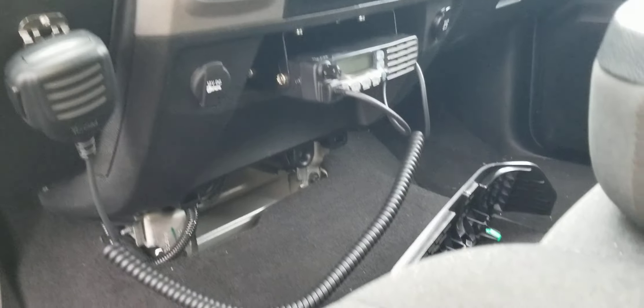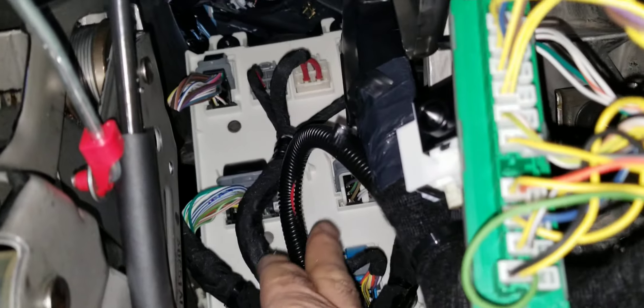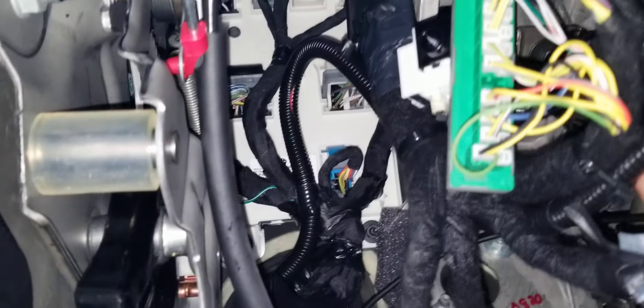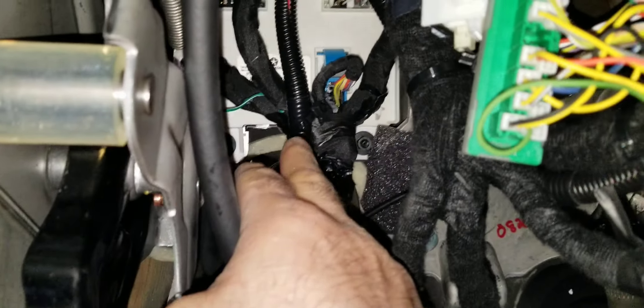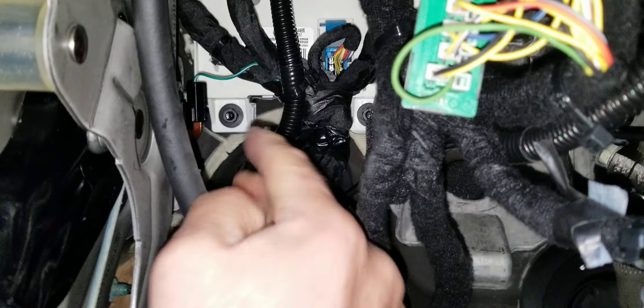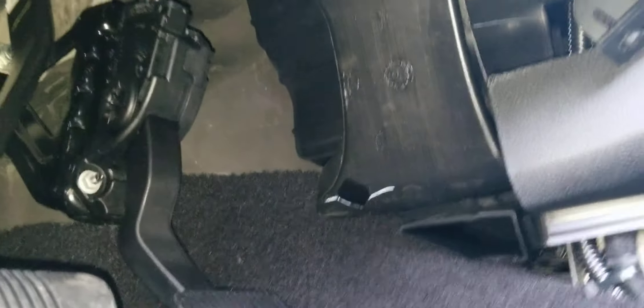As you can see here, there's a wiring harness — I build this harness and tie it to an existing harness so nothing is pulling other wires. It comes from that grommet — the firewall grommet, the big fat one. I had to slice a little opening on both sides, and as you can see, you won't see any cables hanging.